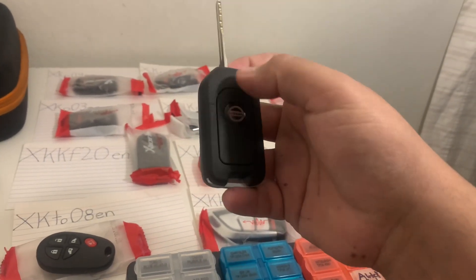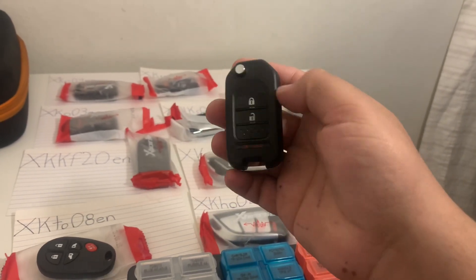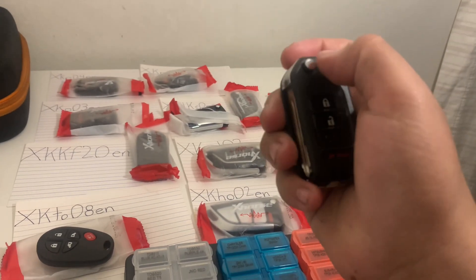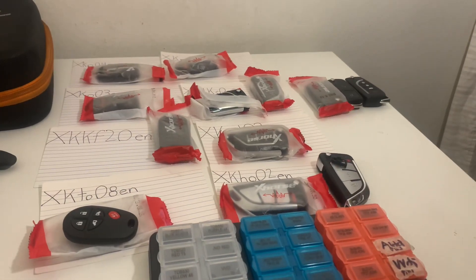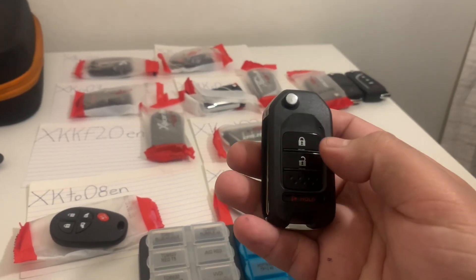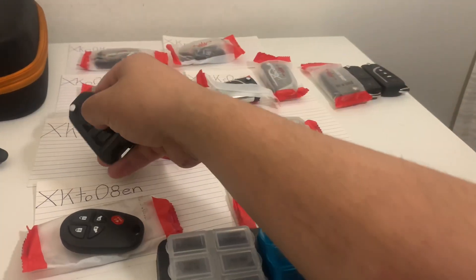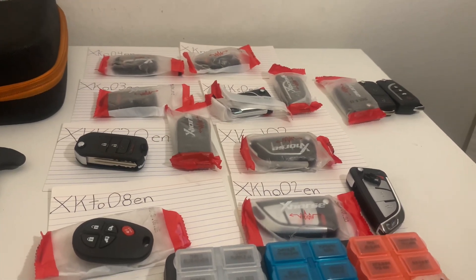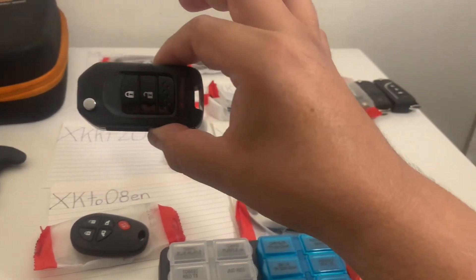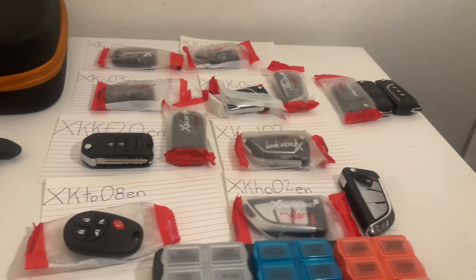This type is for when they want an ignition key and a keyless entry remote but it's for a non-transponder vehicle. I typically use this for metal keys paired with a keyless entry remote. This is a popular one because a lot of keyless entry remotes had lock, unlock, and panic — that's a very popular build even now. I'm not sure why XHorse didn't make a wireless super remote version of the three-button, but they made one with a trunk button that doesn't come up that often.